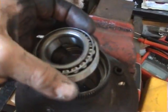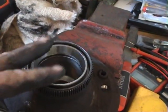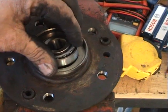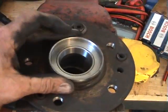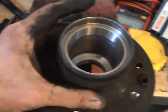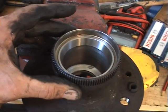This is the inside bearing. The inner race — that part — goes to the inside of the car, so I'm going to tap that piece in all the way home. The outside bearing goes to the outside of the car, so this part goes in like that. It's much easier putting them in than taking them out. Have a look on the inside when you do this to make sure they're in as far as they can go. Now I'm going to put the inner bearing on for the inside of the car, put the dust cap on, and grease it all up — plenty of grease.